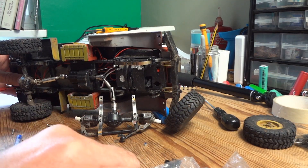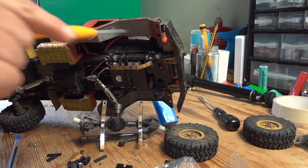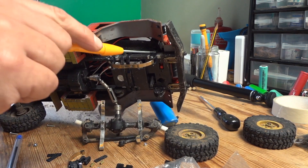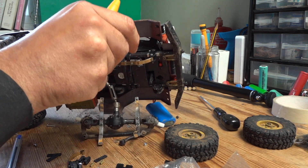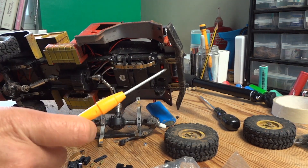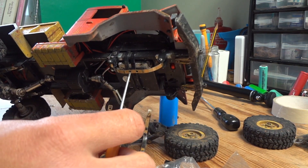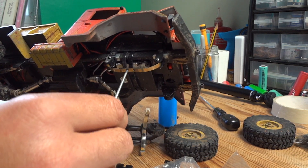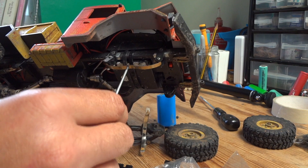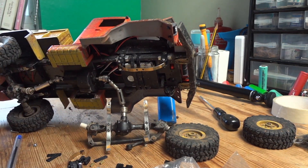I've managed to sneak the new brackets in without having to take all the bodywork off — literally undo those two screws, circle the other ones out, and these sort of hook in. It's worth noting that this little hinged portion of the kit should hinge backwards, so when you press on the spring it goes like that. If you do it any other way it doesn't work properly.